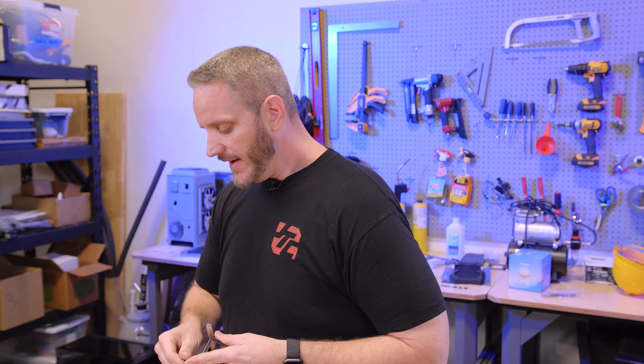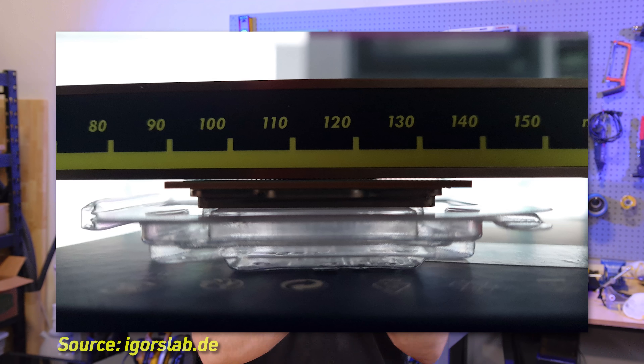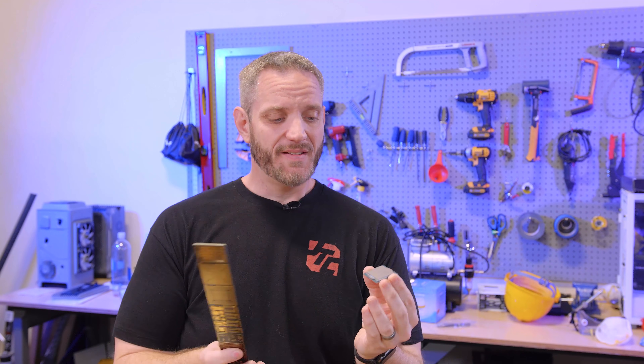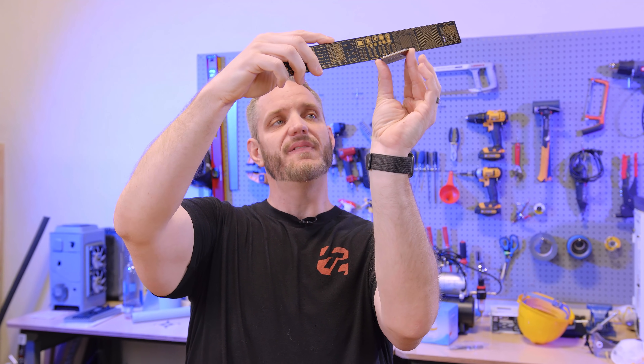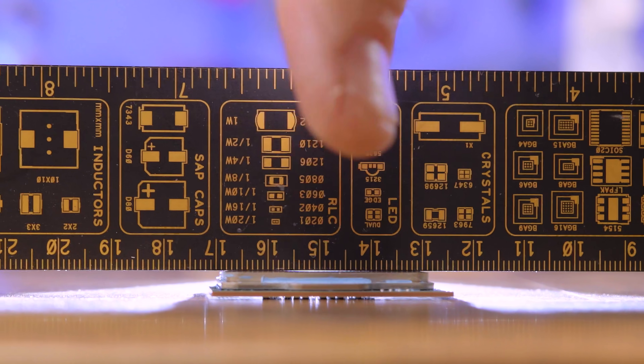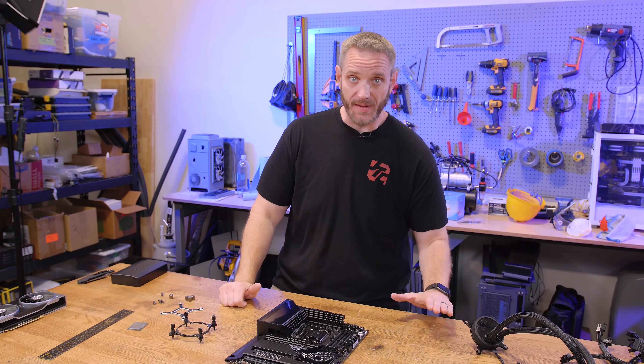What's that causing? It is causing an actual bow to happen with the CPU itself. My CPU, if I look at it — I know you can't see this on camera but I'm checking it myself — yeah, that's flat, there's no bow there. But if I take a look at my edge here, I'm seeing all kinds of light, which tells me my IHS is concave. I've got light in the center and not on the edges. This is something we've known with Intel CPUs for a long time. I've lapped them for generations, and we've showed you how I've dropped temps by 10°C just by lapping the CPU.